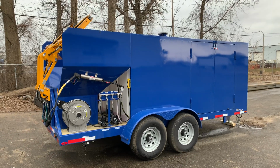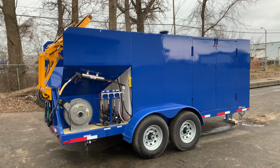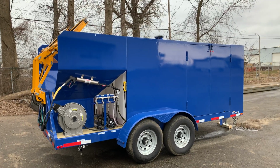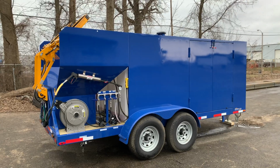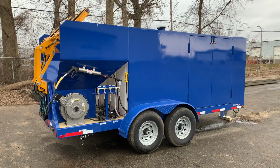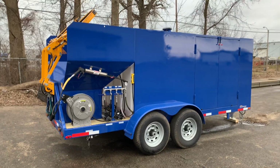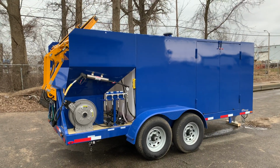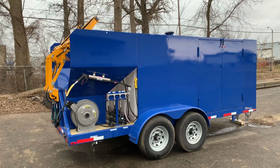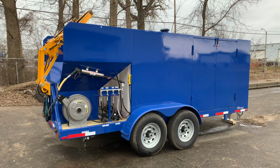So you have to be aware, if you've got a 525 gallon tank on the back of the truck and a 525 gallon supply tank, you cannot put those on NRRs or NPR Isuzu. They're lighter duty, 14,500 pound rated trucks, 16,500. That much water requires at least a 20,000 pound rated vehicle. Be cautious, because there are definitely builders that are building these things that are literally going to put you in harm's way and financially devastate you, because one thing that insurance companies will not pay any claim on is if they deem that your vehicle was over cargo weight. That voids your policy and can literally financially ruin you.